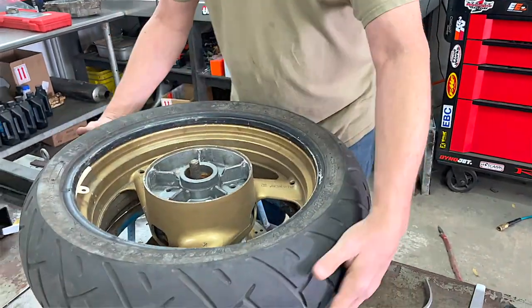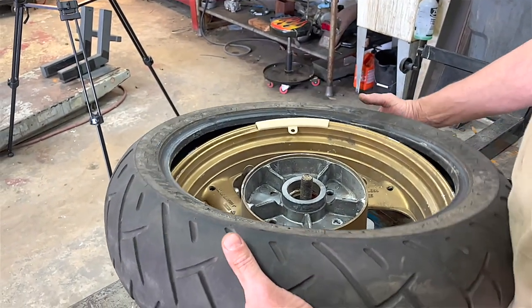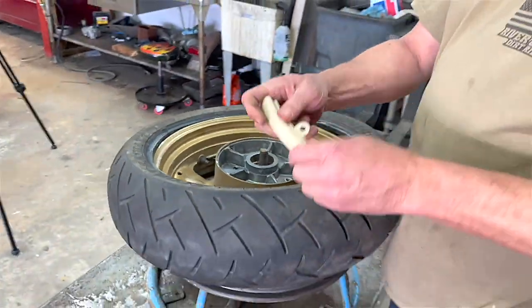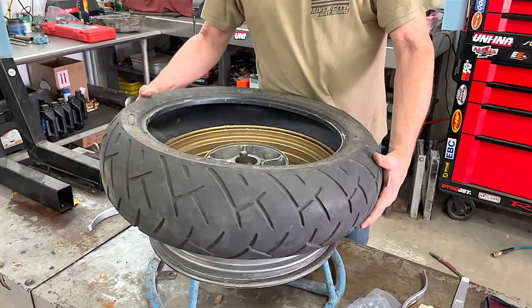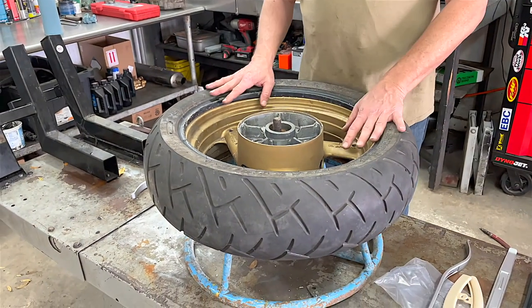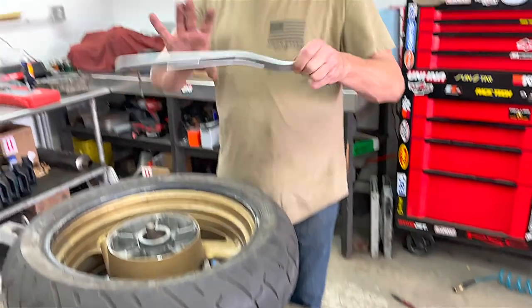Now you're down to just needing one. A little at a time. And we're up and off. Once we've got our one side of the tire removed from the rim, we're going to remove our rim guards. Really nice flexible plastic here. Then we're going to do the exact same thing on the other side of the tire. Take our tire off. We can put a new tire on, replace the tube, do a patch, whatever we need to do. We've got our new tire, we're going back on. We're going to use the opposite side of the tire irons for install.